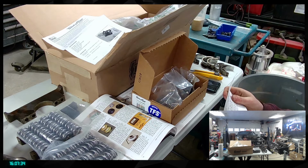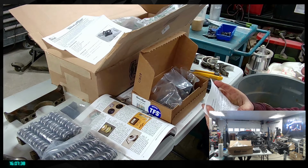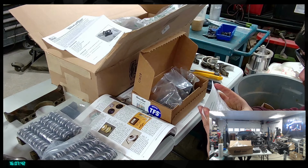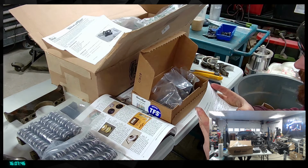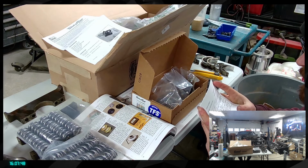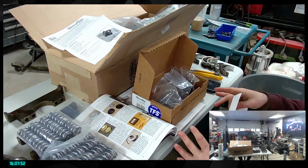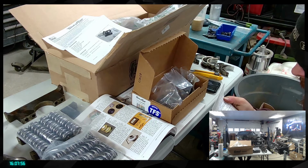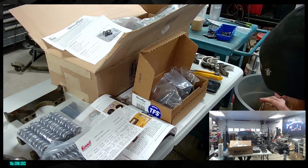All right, so it's supposed to be the stage 3 turbo cam for that. So we're going to have the valve lift at 0.60 and 0.57, so we are in the ratio. This is a kit that was sold all together basically, so we should be doing pretty good on that. I'm going to make sure it is actually the right one, but here we are.